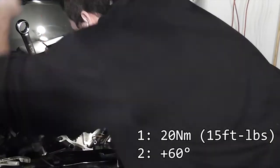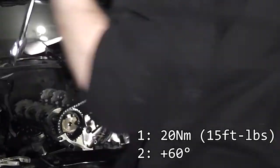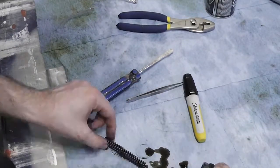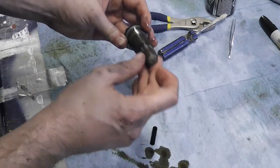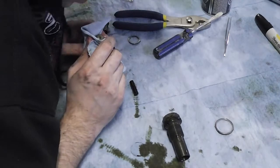It's a good idea to have an extra set on hand in case your timing is wrong. We will check the timing after installing the chain tensioner. Attach the top guide rail and torque the two bolts holding it to 10 Nm. Now disassemble the chain tensioner: unscrew the end cap and take out the spring and the small internal black pin, then pop out the tensioner body.